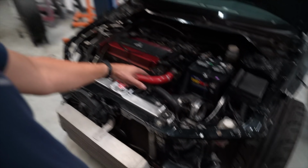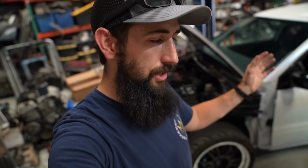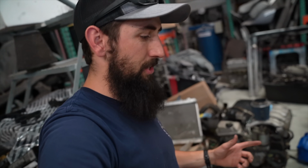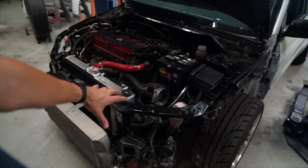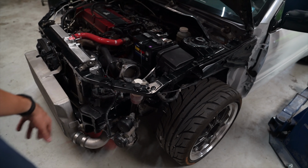This turbo feels like literally you touch the throttle and it's at 7 pounds of boost. And it was pretty lean, about 14 something, which for 7 pounds of boost on a tiny turbo at like 10% throttle load, I don't think is really a bad thing. But we don't want to be doing that very much in the future. So I'll play with the ECU stuff a little bit tomorrow and see if I can get a base map, and work on it from there.